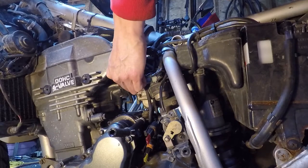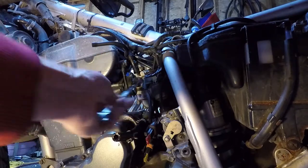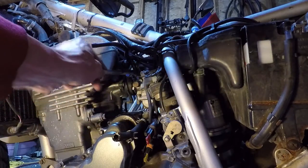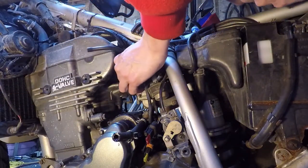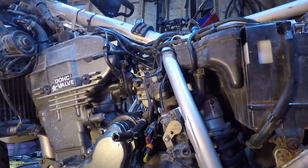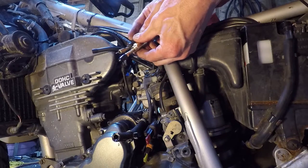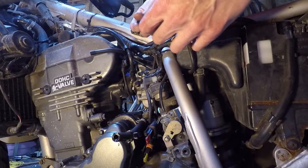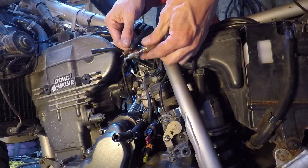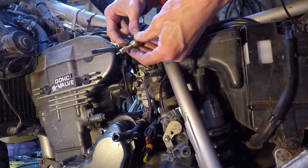Good thing I thought ahead, because getting the carbs off these bikes is a bit of a pain. This should screw out quite easily — we'll get rid of the whole cable assembly and pop in the replacement piece. There we go. Let's compare the threads. Same pitch and diameter, and this one has a little cover on it. We'll compare the enricher valve ends — they look to be the same to me. So we'll fire in the new one.